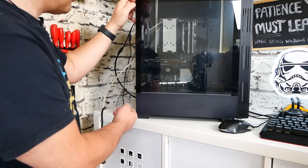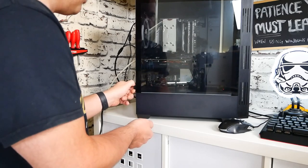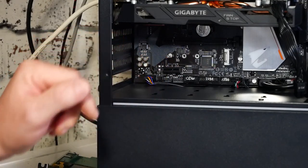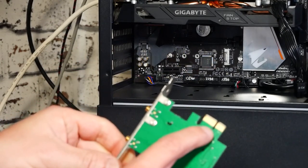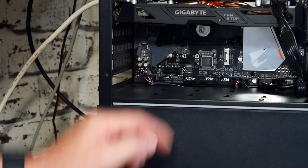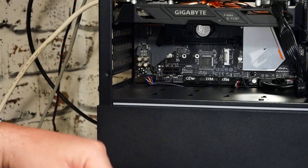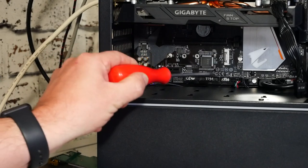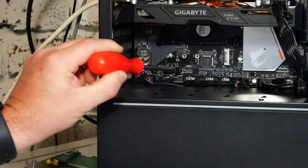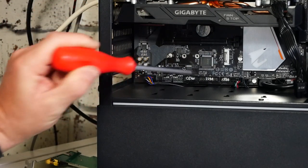Once you're happy that all the power is off, you can remove the side panel screws in your case — generally you're looking at two screws or two thumb screws for side panel removal. Take the panel off and put it to one side. This is the bottom section of our motherboard and we're looking for a slot for our PCI Express. This is an x1 slot. I've got one in the bottom corner — there is our additional USB port there which we can plug into, and there is our PCI Express x1 slot. We're going for the lower one, because of the way it will take resources from the system, we're going for a lower priority slot at the bottom. What we need to do is remove the back plate from the back section — normally it's just a single screw to remove that retention plate, or you may have one which you have to wiggle and then pull out.